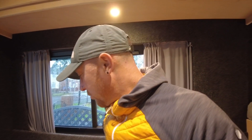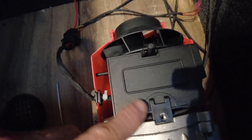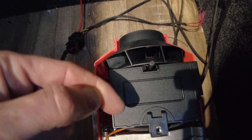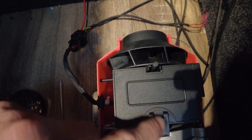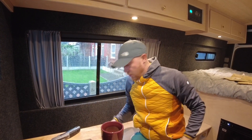There's a little bit of noise coming from it. It's not mega loud, but depends how fast the fan's running — it just seems to be rubbing on a bit of plastic. Sometimes the fans just need pushing out a little bit. I think we've fixed it. If you're just looking here — it's a bit dark — just this little bit here that actually comes off, it just lifts out. There's an elongated hole for a screw. The back of this is touching the metal, so it won't come any further this way. But if you just cut a slither off this plastic, move it this way a bit, and then screw it back in, this fan seems to be freely moving now and it doesn't seem to rub. So I think that should have fixed it — I'm just going to screw it back in and then start it up again and see if we've reduced the noise a little bit.